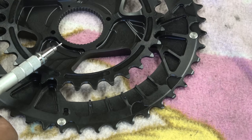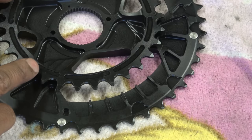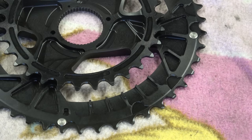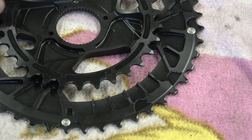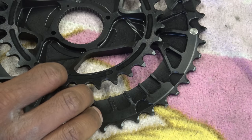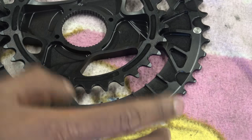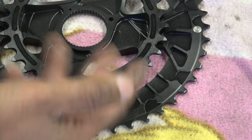This really is a work of art. It's one piece of metal — looks to be forged or possibly billet — 7075, and you can see the path where the cutter has gone over and made that in one piece. If you were the CAD engineer or the CNC man who programmed the machine to do that, you'd be giving yourself a pat on the back. On this channel where we praise engineering, I'm giving you a pat on the back as well, because that is really quite good. In terms of dimensional accuracy, I'll show you that in the PowerPoint.